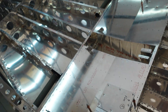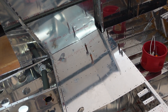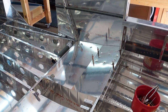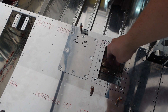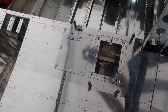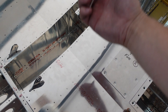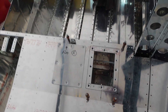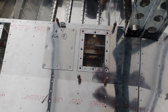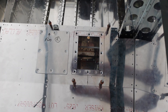Operation com antenna access panels is complete. Left one there is secured temporarily so you can get an idea of what it'll look like — obviously you won't see it when we have the rear seat in. Nice and flat. Another method I saw is the traditional access panel style where you drop it in and have a backing plate inside as a support lip to keep it totally flush. I didn't do that because number one, the plans call for LP4-3 rivets — protruding domed-top pop rivets — so Van's is not concerned about things being totally flush here. Also, that inset flange approach decreased the amount of space to get a hand in there.